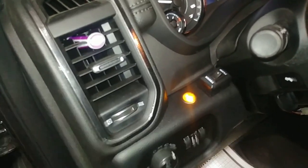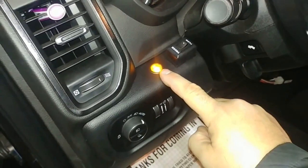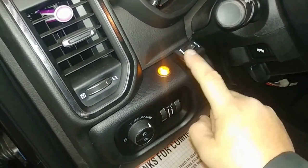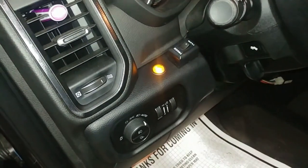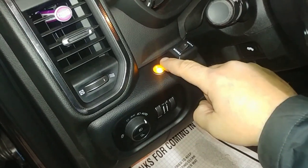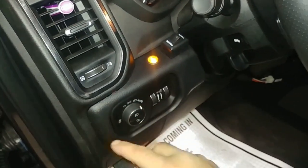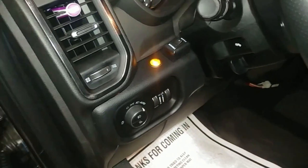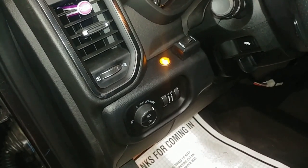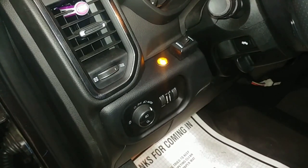As far as switching, what we did here is right here in the cab we drilled down right here. The customer liked this idea for a couple of reasons: one, this panel is cheap and easy to replace; two, it's right next to his truck and plow headlight switch so it works out very well. We used a full illumination amber switch because most of the lights are indeed amber. You do have to notch just a little bit of plastic behind this panel, but you can remove it before you drill — it just pops out very easily. You'll be able to put that three-quarter inch switch right there. As far as power, we ran right to the battery so he can use these lights anytime he likes. There's a nice factory area with a plastic cover that you can drill through on these Dodges — no issue going through the firewall at all.